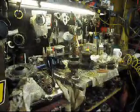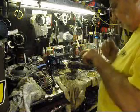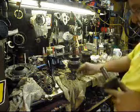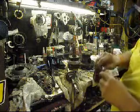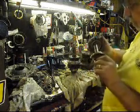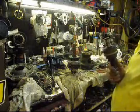Back at Geno's air-cooled. Adjust the camera a little bit. Third gear's ready to go. Now we're going to put the oil around here. There's only one way this goes on — there's a groove here, you can see the groove, and it's tapered. But that doesn't always mean the drum's on the right way, so you've got to check both ways. And then we will press this on. If the clearance is right, we'll put fourth gear on. Gear stacks will be ready to go together.